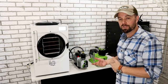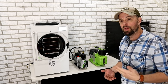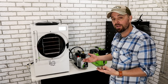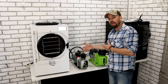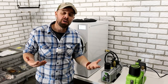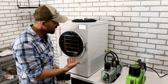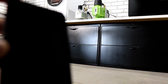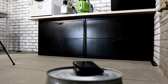Let's move on to our second comparison, which is going to be a pretty big factor in people's decisions: the noise these pumps put out. A lot of people don't realize that most of the noise from a freeze dryer setup comes from the vacuum pump. The freeze dryer itself is actually relatively quiet — similar to a refrigerator, with that same kind of compressor/condenser sound. The vacuum pump can potentially be noisier than the freeze dryer. I'm going to measure the sound using a sound app on my phone, placing the phone an equal distance from both pumps and running both on the same machine with the same hose — the only variable being the pump. The phone is sitting about six feet away, and the standard pump is hooked up first. I'll capture the sound all the way from startup up to about 1,500 millitorr.